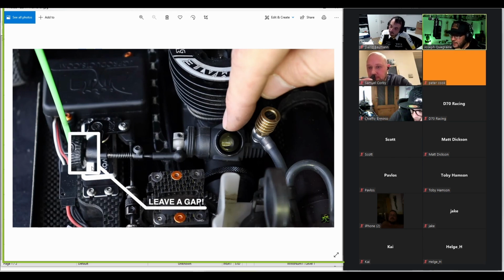Now, if I go to the longer position, then I will feel that the throttle response is more aggressive, more direct. So that's also yet another way to tune your response. And the same goes for the steering. The length of the steering servo arm will affect your steering feel also. So that's also an adjustment you can do. My recommendation would be that you go for the shorter option because it will most likely be easier for you to drive. Less responsive, smoother operation, easier.